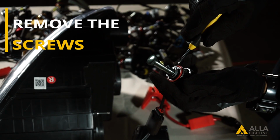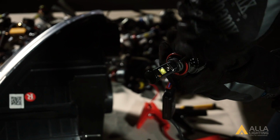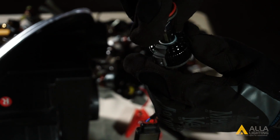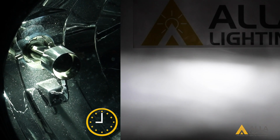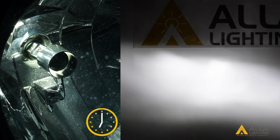Bulb 4 is also adjustable if you remove the screw on the chuck of the bulb. This bulb is not normally adjustable, however, we are still able to adjust it by removing the screw. Let's twist the bulb inside of the housing to adjust the beam pattern. This vertical orientation is also the ideal placement for bulb number 4.